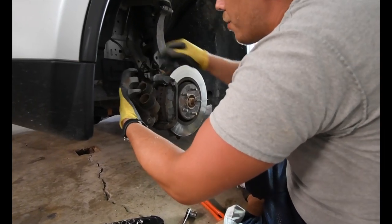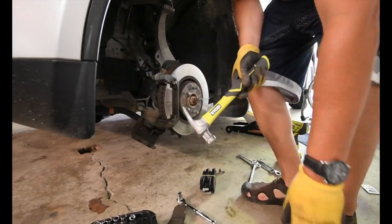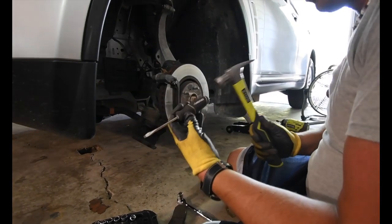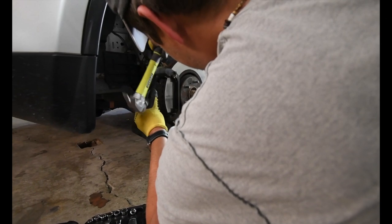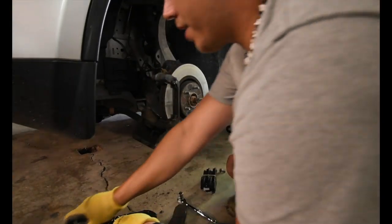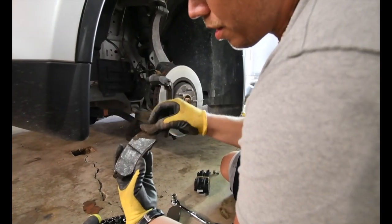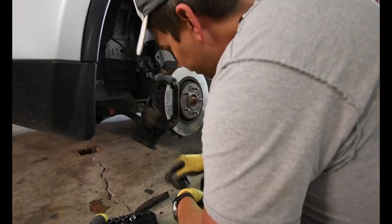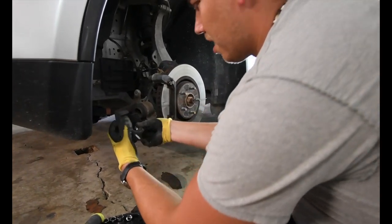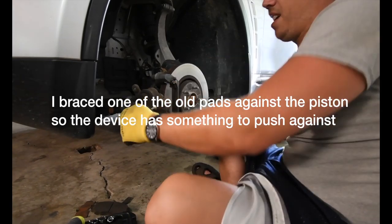There's the caliper. I have two pistons to push in on this one. I was about to grab a regular hammer when I got this one. There we go - yep, that's the one that was screwed. Look at that - that's missing. Yep, there's my problem, right there. Now this is the hardest part of this job - putting these pistons back in place. It's going in pretty easily actually, not too shabby.